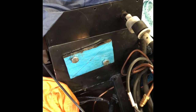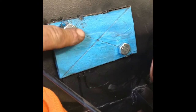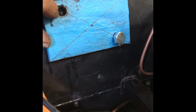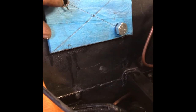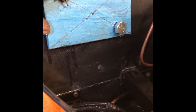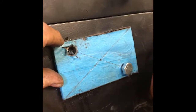This plate is really just to bridge the gap and give me a mounting plate for the new master cylinder. What I intend to do is drill - it's called counterboring - so drill the hole from this side about halfway through so that the head of the bolt goes into it. I might even put a cap head bolt in so it sits just below flush of the surface, then weld it all up so it's effectively captive. That way you only have to get to the inside to do your nut up.